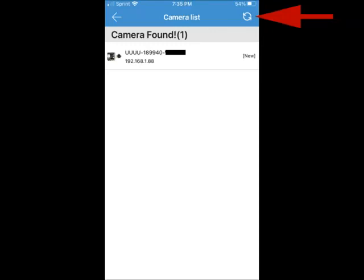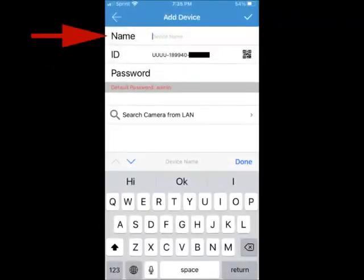This is not a known issue for an iPhone, but most Android phones will have this Wi-Fi connection feature, and you will need to disable all settings regarding it and try again. Click on the camera and proceed. Name the camera whatever you would like. The default password is ADMIN and it's already embedded, so just hit the check mark for the next step.